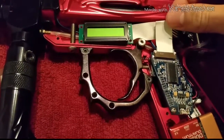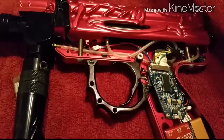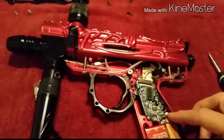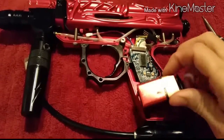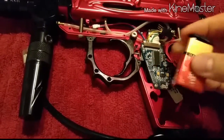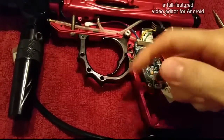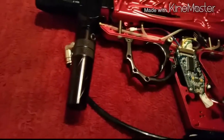I'm going to take a tiny little screwdriver, pop that up, and this ribbon cable should just slide right out. I'll remove that to the side. I should also probably take the battery out so I don't cause any damage — getting the batteries out now.